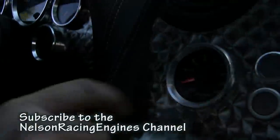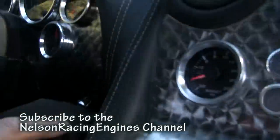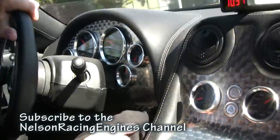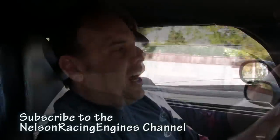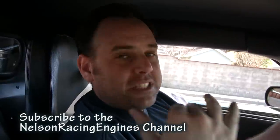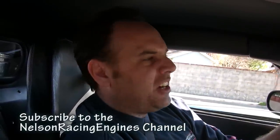This car's got over 20 inches of manifold vacuum. It just shows you how tame the cam is. I'm taking my time, I put it in second gear. I'm stepping on it at a very low RPM. There is like zero turbo lag to this combination. And at 5 pounds of boost, I don't know that you would ever need any more in this car. It's just like a full-blown rocket ship. And you can see I'm driving this like a grandma right now, but it's just like, bam! It's pretty bitchin'.